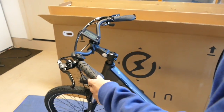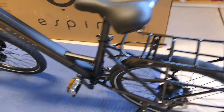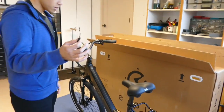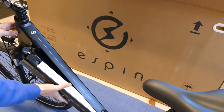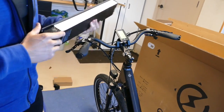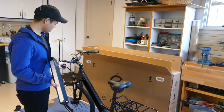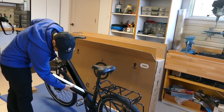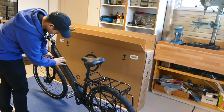This battery is already charged, but before your first ride you're going to want to make sure the battery is completely charged. To remove the battery, locate your key, insert it into the key pocket, turn it to the left, and the battery will pop out. To charge it, there's a rubber gasket here which you remove. Once the battery is fully charged, reinstall it — use the bottom part to make sure the connectors are connected, put it in at an angle, then pop it in. You'll hear a click sound, which means it's secured.